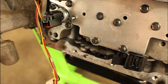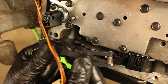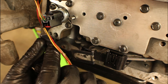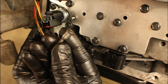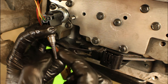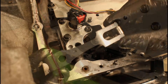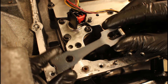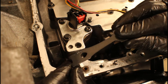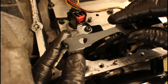There's a little notch or groove right there. I'm going to grab the roller portion of the detent and insert it into that notch. Then we're going to position it over and line up the hole for our T25 special fastener. It's got a head up top and then a collar or sleeve portion that's wider than the diameter of the threads — so it's a special fastener. When you go to install this detent, you need to be careful: this little hook portion on the end needs to go on the outside edge of the valve body. Don't line things up and start tightening it the way it is right now, because it's going to squeeze, flatten, and damage it.